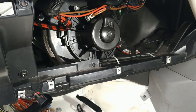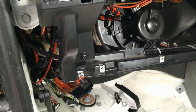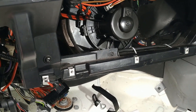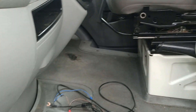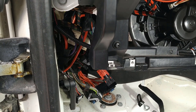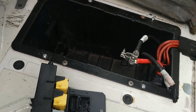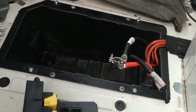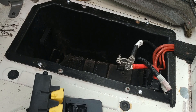I haven't got anything specific in mind for the ignition feed right away, but the D-plus signal is definitely something I wanted to find. It's damned annoying that they haven't presented it as an optional extra in the driver's seat the same way they do in the Sprinter, but at least I found it and I can now make a connection to it. One thing I should have said at the outset — this is definitely a job to do with the battery disconnected. There's a lot of electrics behind this panel.